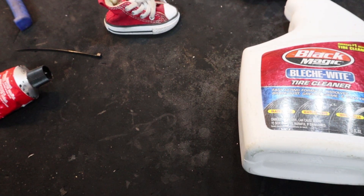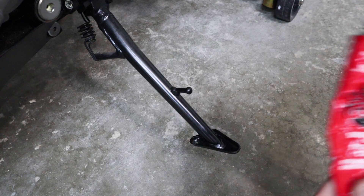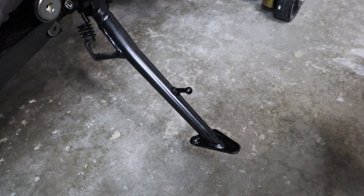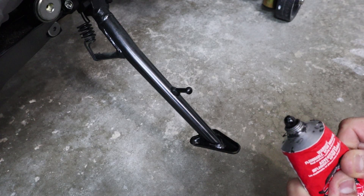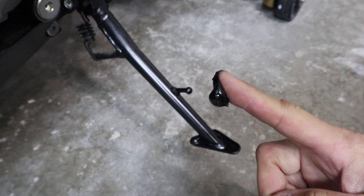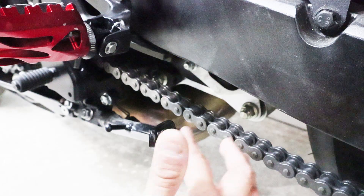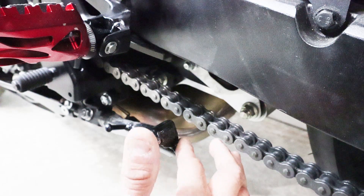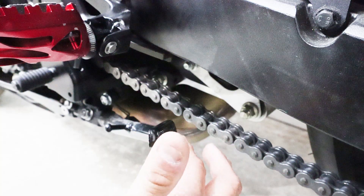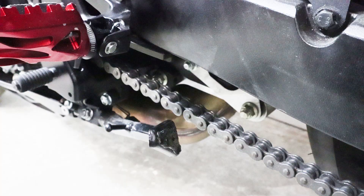Let's go over to the bike and install this little guy. We're at the bike by the side stand. First things first, we're going to put a little bit of the black shoe goo on the bottom part of the side stand. Just unscrew the tube — you don't need to put that much. Squeeze a little bit out, put it on your finger, and work it around the bottom of the side stand. All you're doing is spreading the shoe goo around the bottom so the shoe won't move around when you put the side stand down. Without it, the shoe will tend to slip and may get damaged.